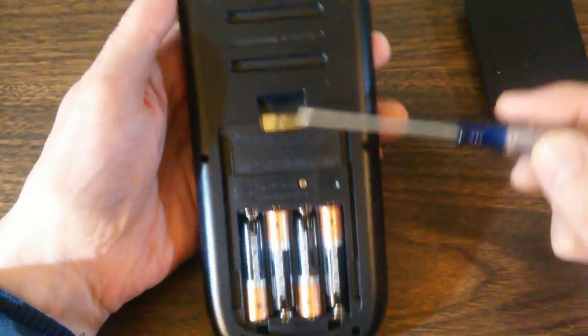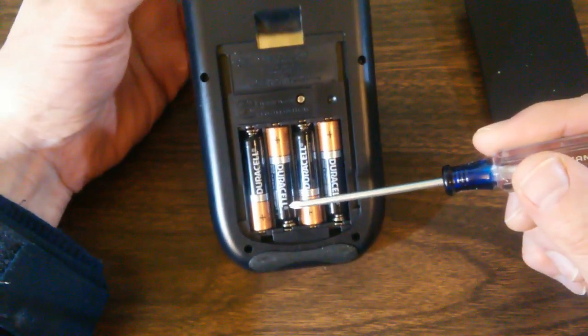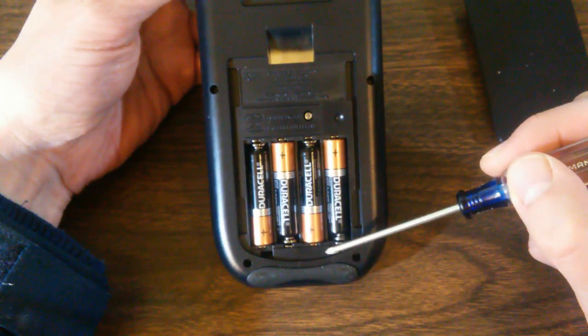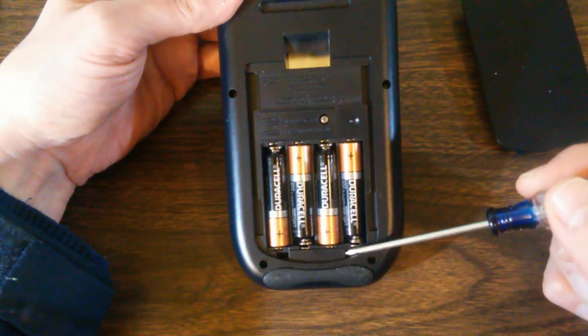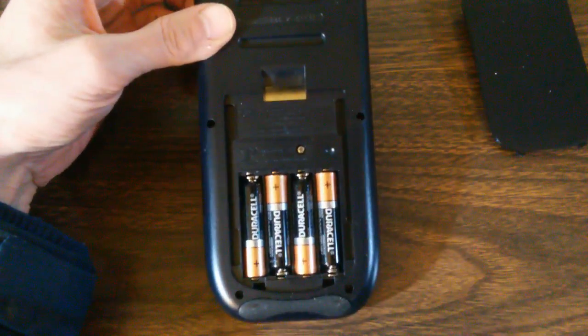The batteries are located on the back cover, and the system board is located in the front cover, and there are two pins from the back cover providing electrical current to the system board. Now, sometimes these pins will wear away the metal contacts on the other side, and you will lose electrical contact, and the calculator will fail.